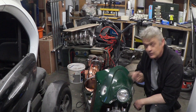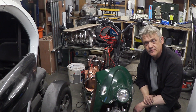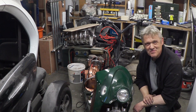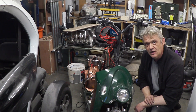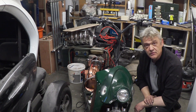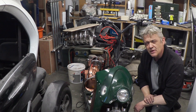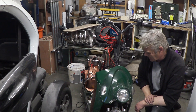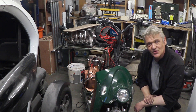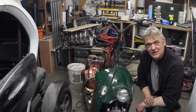I thought I would share how to make these formed panels, because obviously beating them out of metal would be quite a job, but forming them with a pre-formed board, a bit of body filler, and then some fiberglass over that works really really well. I wasn't going to do the panels but I thought I'd missed a whole section out. I think I'm failing to capture steampunk but I'm doing really well in a Wallace and Gromit look, so I'm quite happy with that. Anyway, finish off the electrics and then get this on the road — hope you enjoyed the video, thank you very much for watching.